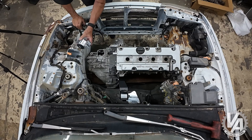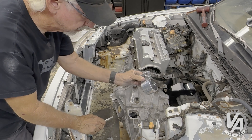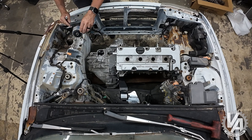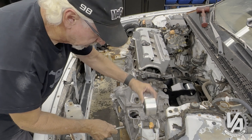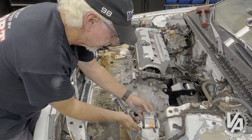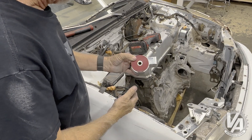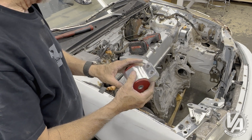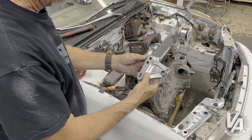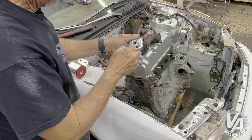For this new mount kit we want to use the flip mounts. I tried using the one we use on the CDK and the BBK and it's a little bit too wide, so we're going to be using the one that comes on the EF. We're doing the higher mounting, so we flip it like this and put it in. When these mounts are sold there'll actually be a spacer in here to keep the mount centered. On the passenger side, this flip mount won't bolt up to the stock block bracket — this spacer can be moved to either position so it'll fit on a K20 or K24, even the K24Z. It has a slotted hole down here to do that. For the K20 you're going to use the three holes that are closer together.